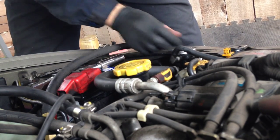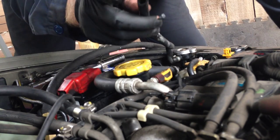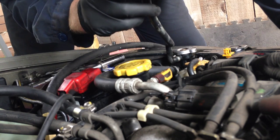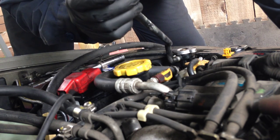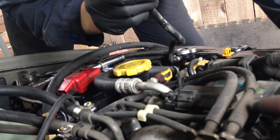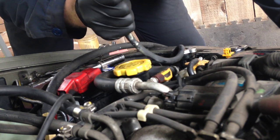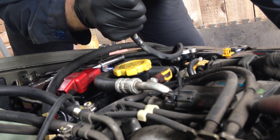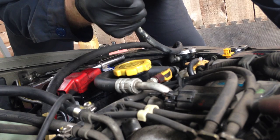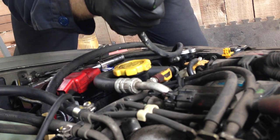We're going to put pressure on the cylinder here. I'm getting a little bit of air coming out of the overflow tube, which is basically letting me know that the air is passing through the head gasket into the cooling jacket and putting pressure on the cooling system — more pressure than the cap is rated at, which is 13 pounds. If there's over 13 pounds of pressure it's going to spew out coolant. As you can see, it's spewing out air. So, bad head gasket.